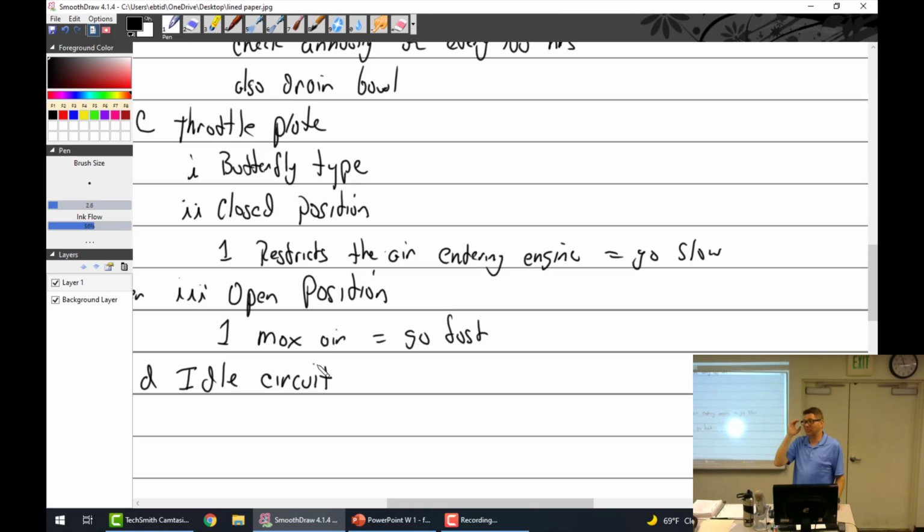Which made me think of something else. But I believe that when the throttle plate is closed all the way, there's not enough air getting around the edges. And so they figured out that that calibrated leak will provide enough air to make the idle that they want out of it. Okay. That's my theory. You'll notice that that throttle plate is screwed in. So using screws and nuts anywhere on an intake system is considered an absolute no-no.